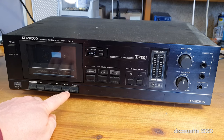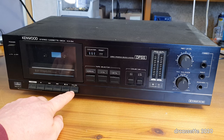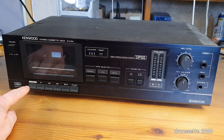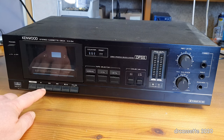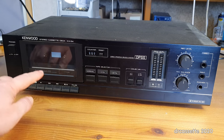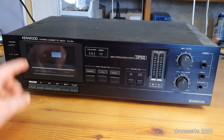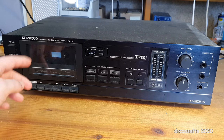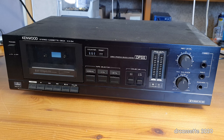This is a soft touch mechanism, which means you still get the traditional mechanical buttons under the cassette compartment. But these buttons are very, very easy to push in — they require no force — because they only select the function. The function is then activated, mechanically engaged, by the cassette deck motor via a very clever mechanism.